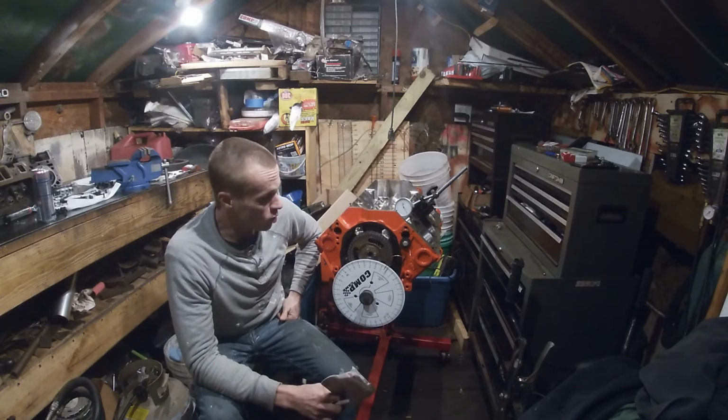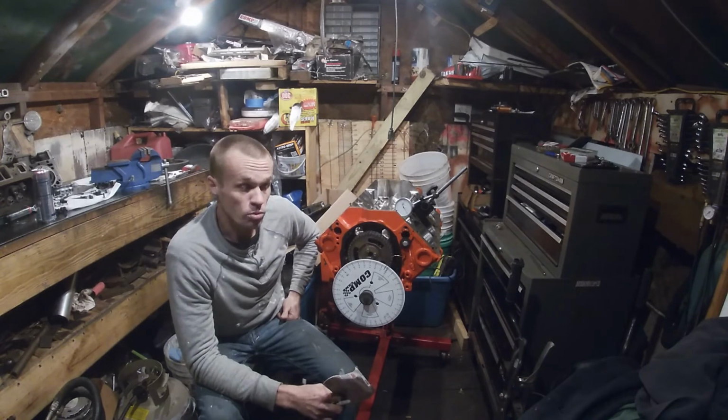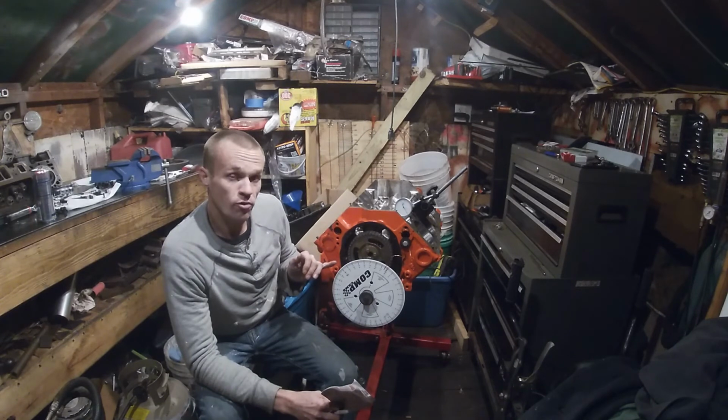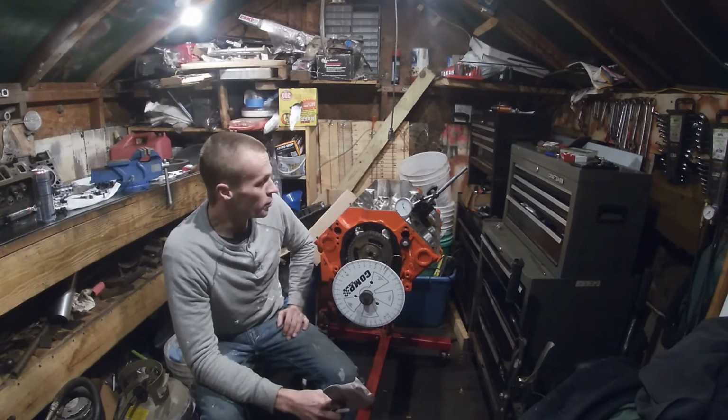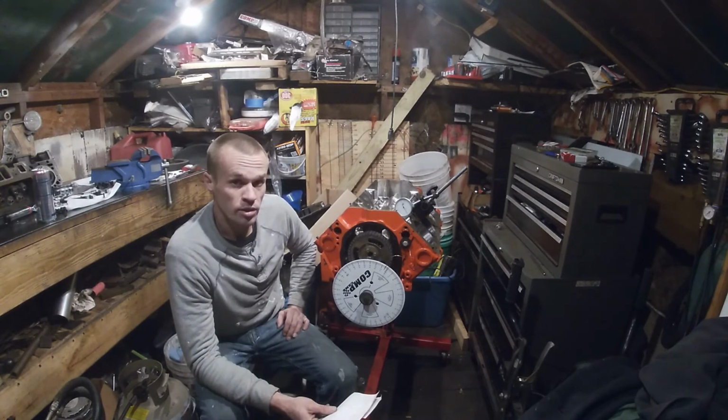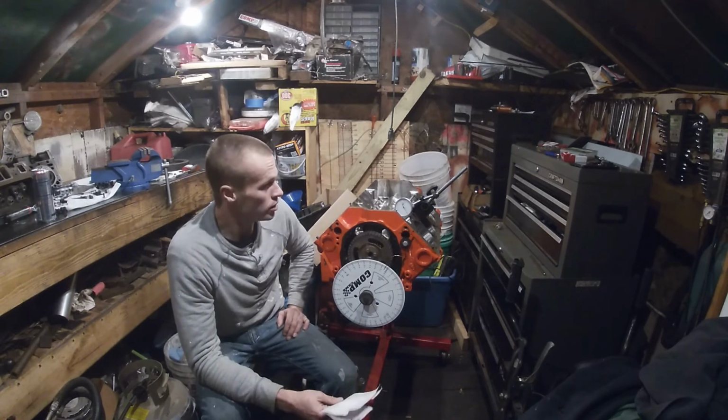I appreciate you guys watching this. I'm going to have another video coming out where we're going to start putting this thing the rest of the way together. I need to put my timing chain cover on, my oil pan, and then we can put the heads on and start checking piston to valve clearance. We can check our rocker arm geometry and find out what length push rods we need.